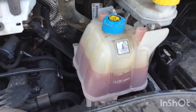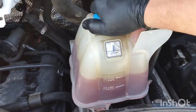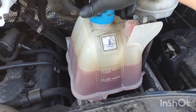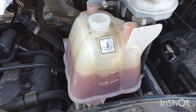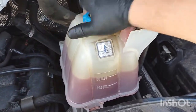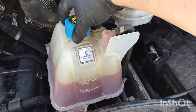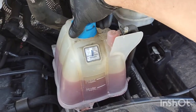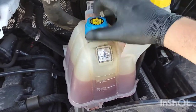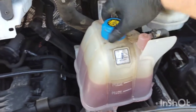First thing you're going to do is obviously pop the hood — open your door, it's right on the side of the dashboard. Then we're going to want to open up the cap, which will relieve any pressure in the system so we don't make a mess when we take the hoses off. Make sure the vehicle and coolant aren't hot. If you recently drove it and it's cooled down, just slowly give it a couple little turns and tap on the top — there's a little valve built into the cap. That'll help relieve the pressure; you'll hear it purge off, and then you'll be good to take it off.